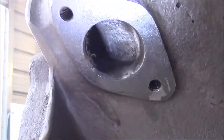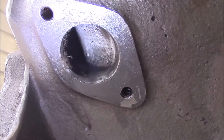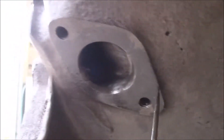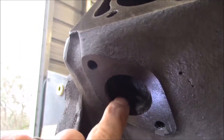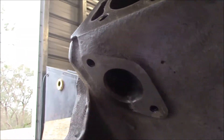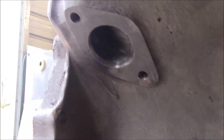Down here, I opened those exhaust ports up to about one and three quarter inches. I did the same thing — took the header gasket, put it on there, scribed the line, and then opened that area up. I rounded it off so the exhaust gases flow better through here. There was some casting wire and a lot of bumps and rough stuff in there, so I removed all that and ground it out, and that'll help the exhaust gases flow out a little bit better.